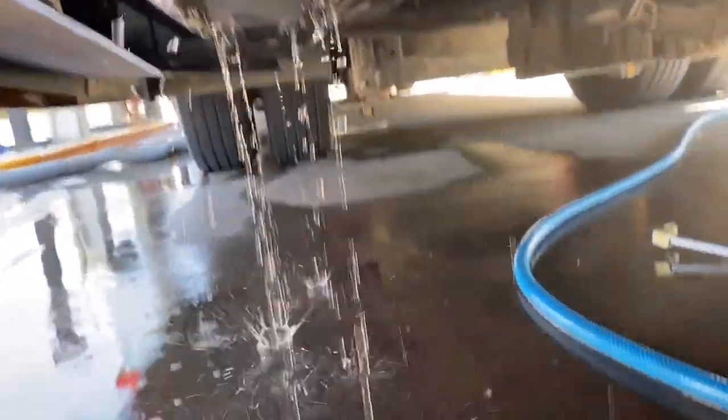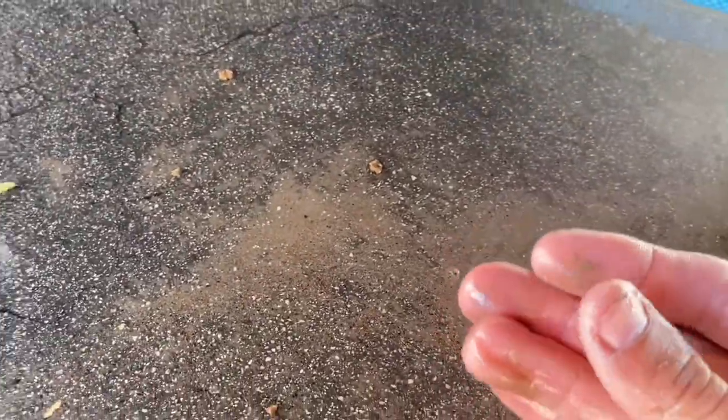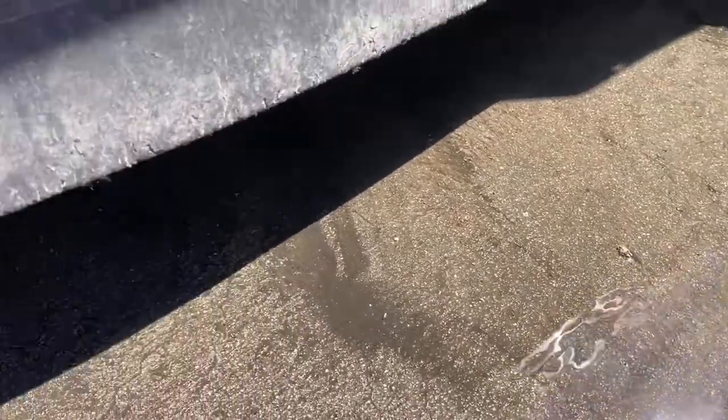When you're cleaning, you'll start to see sediment coming out — this is good, this is what we want. Look at all that junk coming out of here: this is sand, all kinds of crud. Keep in mind, I did this three weeks ago and just the dirt roads out here in Colorado have already filled it back up. You can see it running all the way out the back of the coach — tons of it, just thin silt.